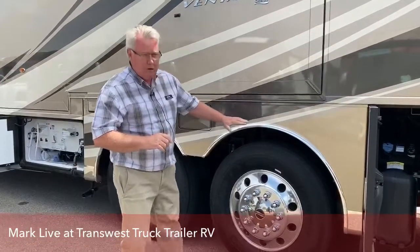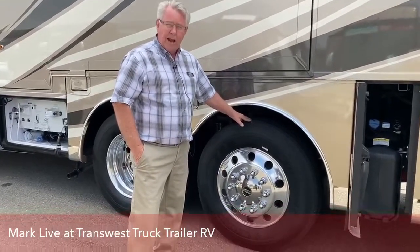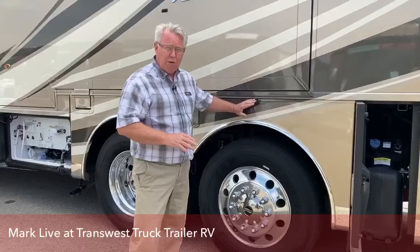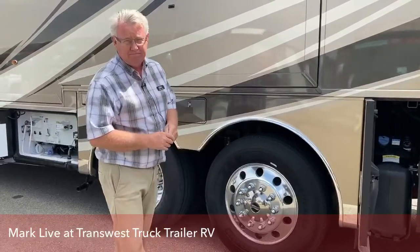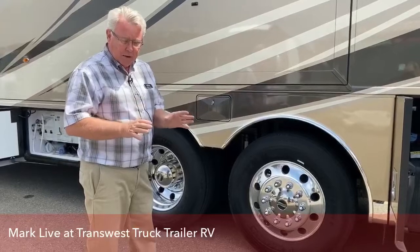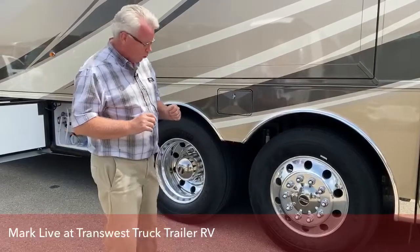They have heavy-duty airbags, and they also have Sachs custom-tuned shocks. Freightliner actually goes out to Newmar, and they tune each of those shocks for the individual floor plan. Sachs, by the way, is a company that's owned by Rolls-Royce. So you put that all together with the heavy shocks, the airbags, the V-Rod connector, and your U-shaped trailing arm, it makes a more stable and more comfortable ride.